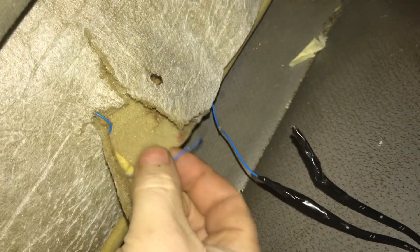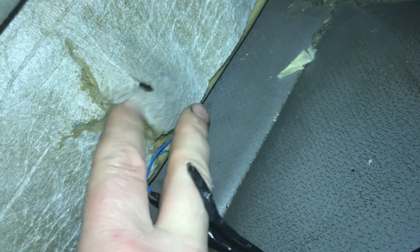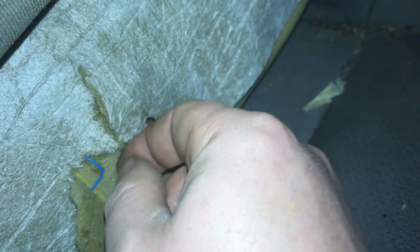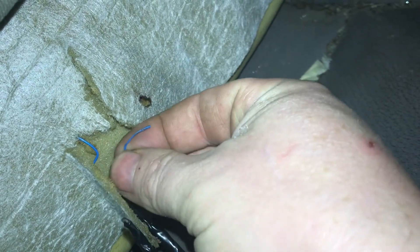Now that the back of the chair has been released, let's go around to the front and see what we can find. We're at the front and we're just going to pull up the material. Aha - look at that, there's a wire broken! That's the cable at the back, that's where it broke. And you can actually see it wasn't just pulled apart - there's a little burn mark there.